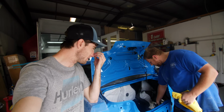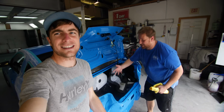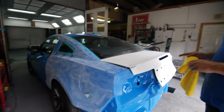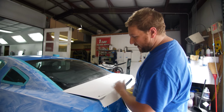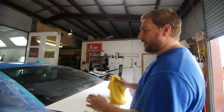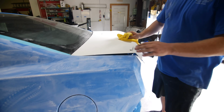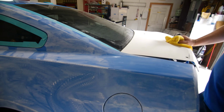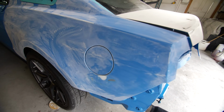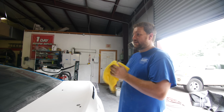You don't want everything glossy in here because from the factory, it's not glossy. It's a tan color with some overspray, really flat too. There's no life to it at all. So we sand it with different grits. For a new panel, or anything we're doing a color change, we'll sand with like 600 grit, 400 grit, whatever it really takes. And our blend panels, we sand with 800 till it's not shiny. We got to get a little primer on this where a dent was. Once we get it all sanded up, we'll get it wiped down, cleaned out, and start taping it for paint.